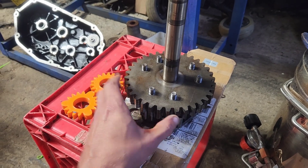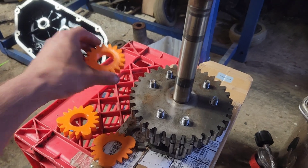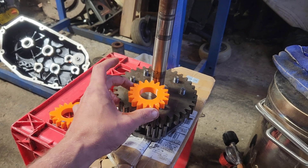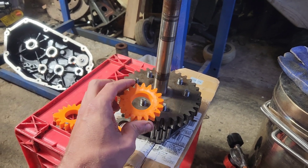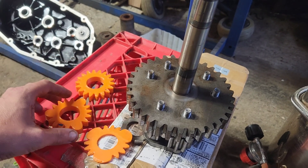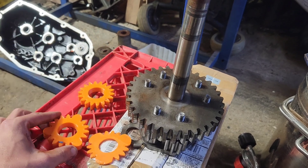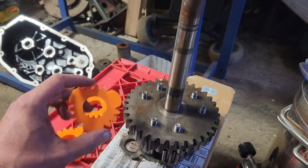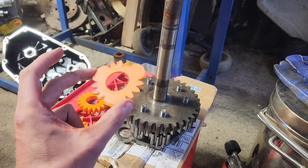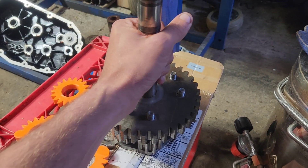On these 633A's with the 6-bolt rear end, the go-to used to be to buy an extra axle gear and just drop it into the center in order to lock up the rear end. But these you basically can't find anymore. So what I did was I modeled that, then modeled a new version, then talked with several people in the mudmower community and the pulling tractor community in order to 3D print out an even better version.